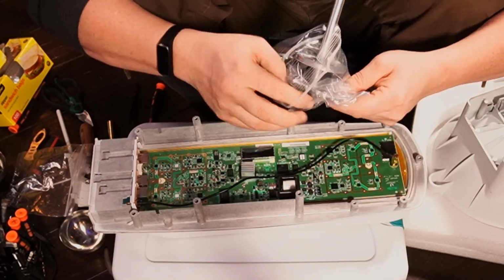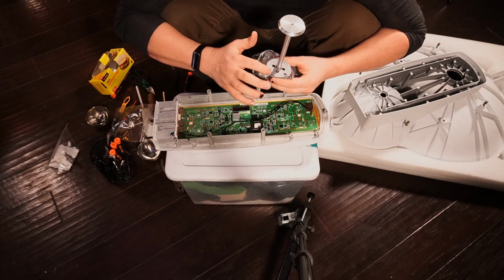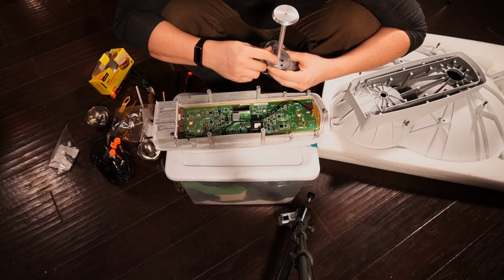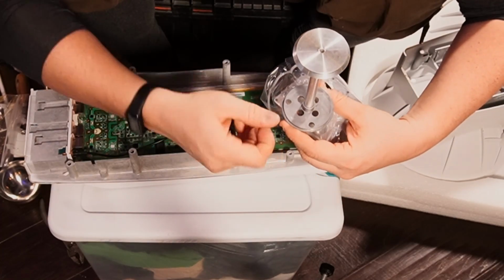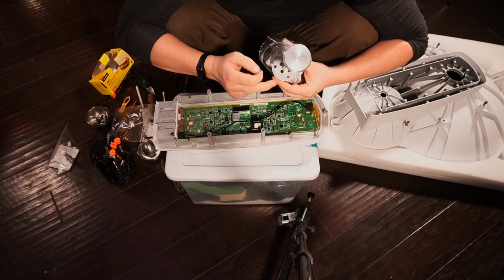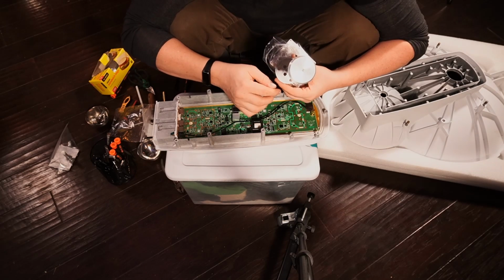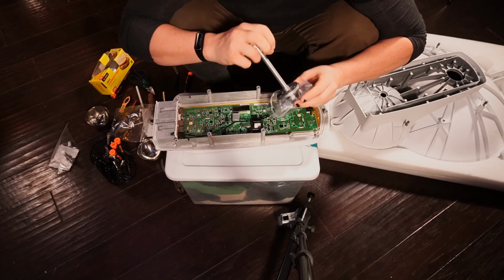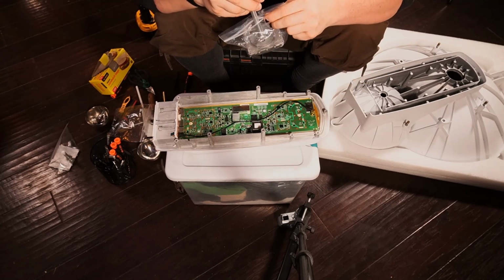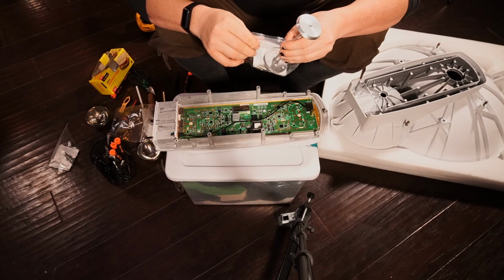Oh, and before I put this away, you can see that in the milling here, there's some flaw in this. There's actually damage, and this is manufacturing damage. So if I, there we go, I can actually pick it off. When this was formed or cast, it looks like there was a little fracture on the surface, or when they were installing this, somebody dinged the side of it or caught a screwdriver on it. So there's a tiny little piece of metal on here, which, given the right conditions, hot, cold, hot, cold, could potentially break free, land on the board, and cause a short.